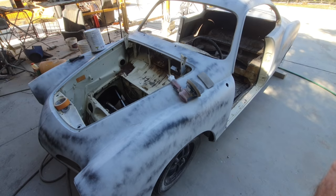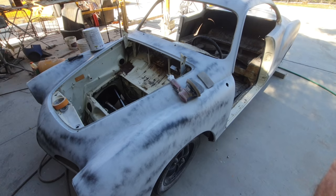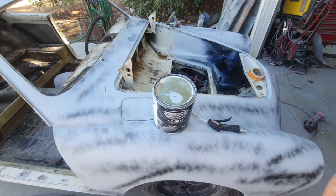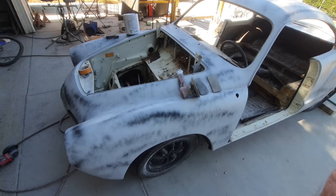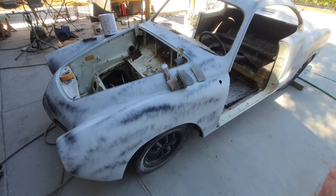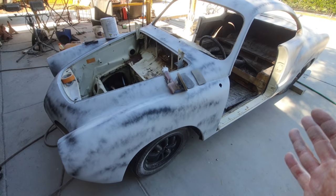And then they came out with the polyester primer, and that stuff is still valid today. There's some of them that have more flexibility to them. I'm not even aware of those really, because this product right here is a happy medium. It sands a little faster than those. So I'm not really looking at those other polyesters now. This product's called like Slick Sand and some of the others. You need to read the specifications on the products, and I always do. Some of those have some flexibility to them.